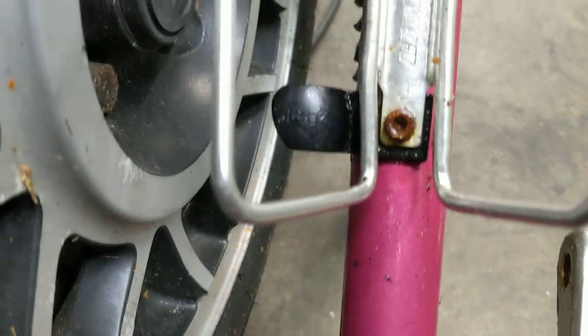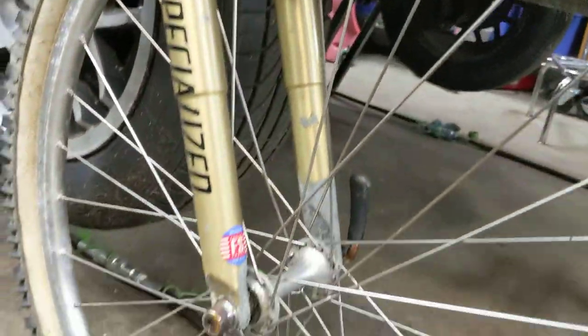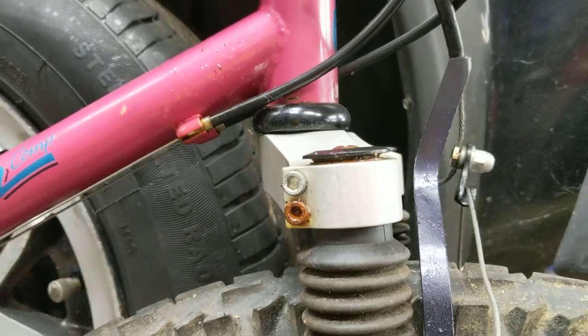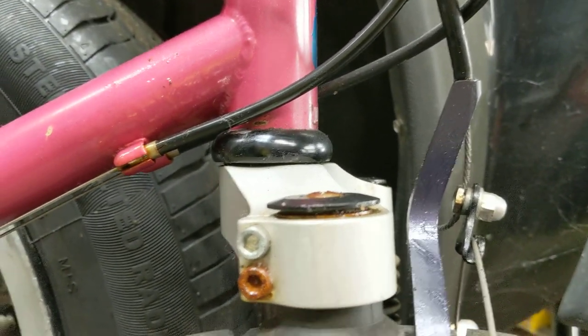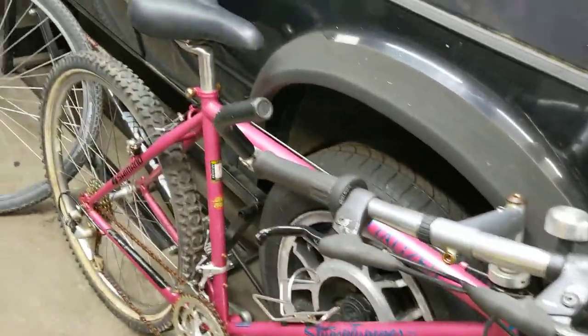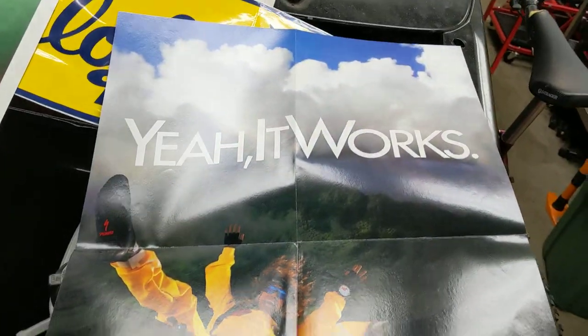There's what looks like a Zefal pump bracket, some No Fear decals — remember when those were everywhere — and Shimano on the seat stays. There's also a Future Shock, which is a RockShox creation. I believe these are aluminum lowers instead of magnesium, but I could be wrong. One thing that's different compared to RockShox is the way they get the offset — RockShox angles the fork legs in the crown, whereas the Future Shock offsets them forward. Having this Specialized here gives me a reason to revisit some of my Specialized gear and pamphlets.